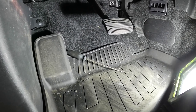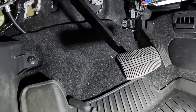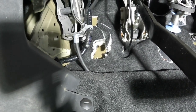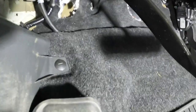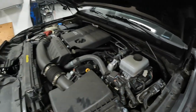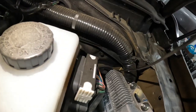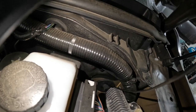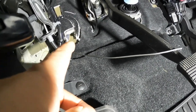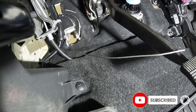Probably the biggest part of this job or the most hassle is getting the wire through the underside of your engine bay into the actual interior of the truck. Up in here — it might be a little bright, the GoPro is in the way — but there's a rubber grommet up in there. Stab a hole through that and run your wire through using a wire or coat hanger. Under the hood we've stabbed fish tape through the rubber grommet; you can see the black rubber grommet down there and that's where your wire will be fished back in.